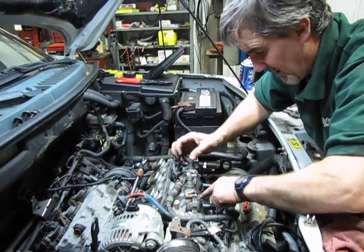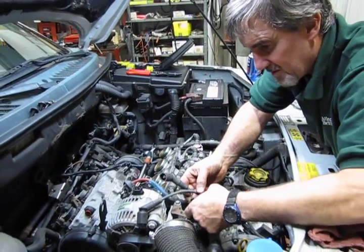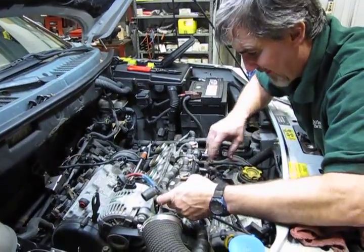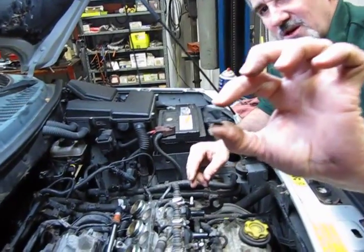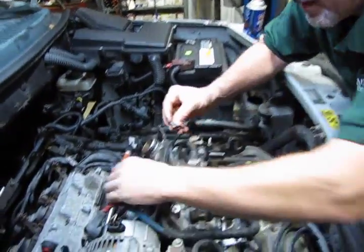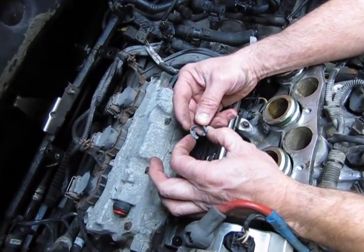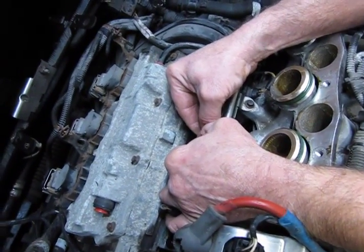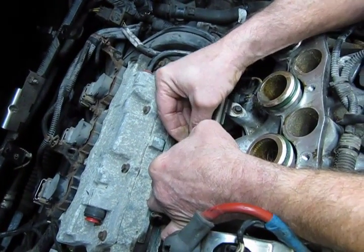And then we'll put the nut on that, we'll torque that in, and then we'll plug the spark plug wires back in. Remember the sequence that we had when we pulled it apart, 3, 1, 5, and you'll be just fine. Right, so just want to remind you, before you put the plastic shield on, you want to make sure you put your retainer clip on the top of the injectors where they mate with the fuel rail. With the solid side down, you've got a small groove cut in the side that grabs this lip on the fuel rail. You just got to find that little slot in the top of the injector.